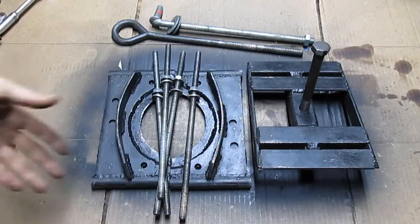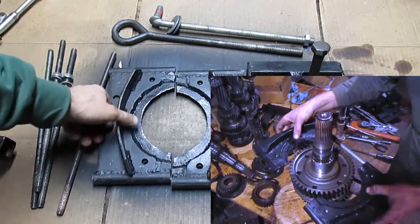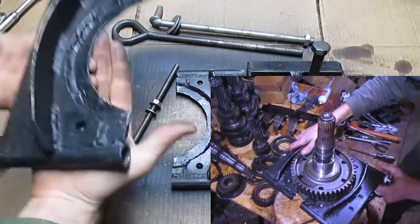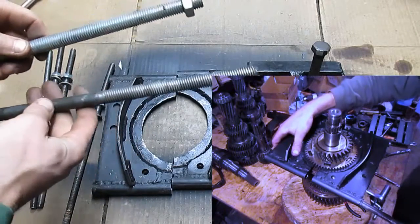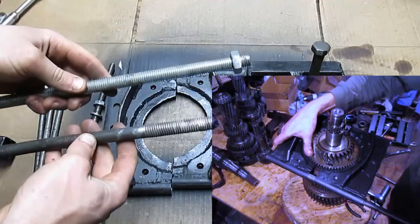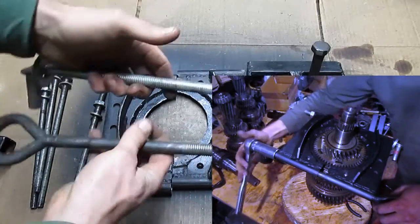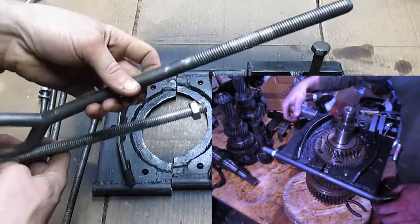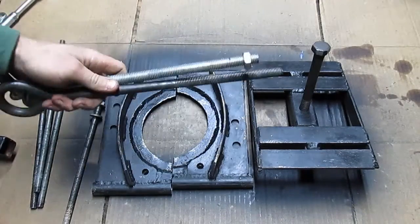You can buy them, but what's the fun in that? So we went ahead and made the gear puller or bearing splitter — pretty basic. You just have to have your base plate here, which is a two-piece so you can clamp the various gears. You're not actually clamping; you're just putting the slip underneath the gear or whatever it is you're pulling on, so you can lift on it. You clamp these two bits together with these guys, which I've had quite a few laughs over. I thought I had 5/8 inch ready rod, but turns out I didn't have chunks long enough for this. So I searched around for what I had, and I found these and I've been using them ever since — they work really well. It just so happens that it's a gate hinge, and I think this guy came from a power pole. That hokiness basically explains the whole gear puller.